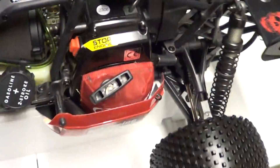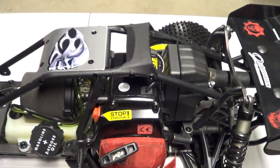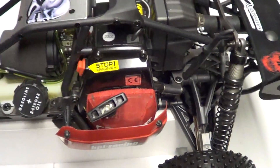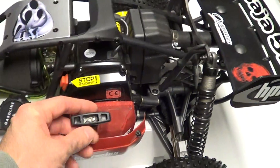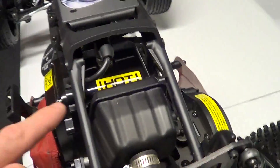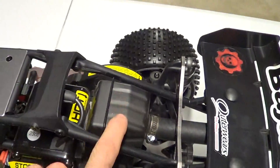These are set up a little bit different than a nitro, and we'll start with some of the basics for guys that are getting into this. I've never seen a Baja buggy that isn't a pull start — I've never seen a bump box or drill start. They've all primarily been pull start. You've got your engine in here protected by the cage. There's a spark plug in here — these run on spark plugs, not glow plugs like the nitro cars.